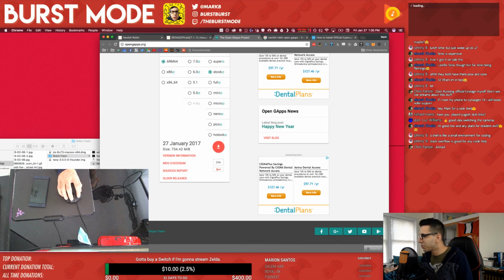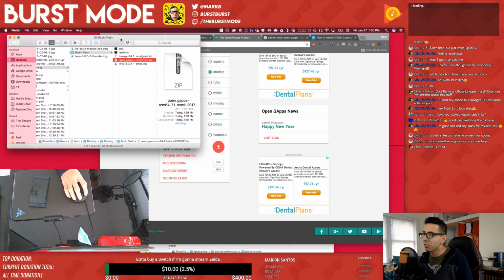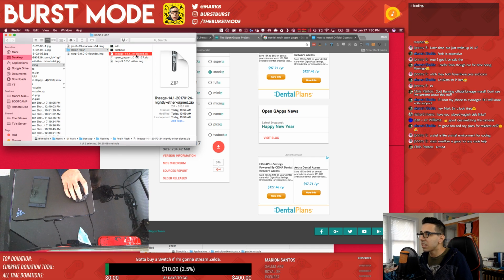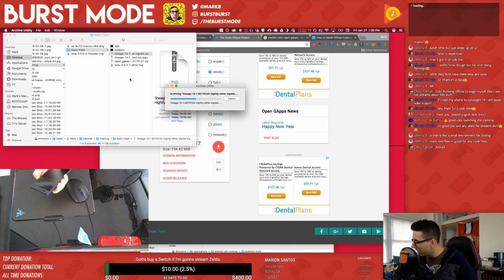I really appreciate it. So now that we've got that downloaded, we're going to pop that into this folder here as well. And then we're actually going to get started with the device because we've got everything that we need here. Let's pop open the Lineage zip real quick so we can show you what's inside. But in the meantime, I'm going to boot my Robin into recovery mode by holding the volume down button and power button while it's off. It should vibrate real hard, and then you'll see recovery mode right here.